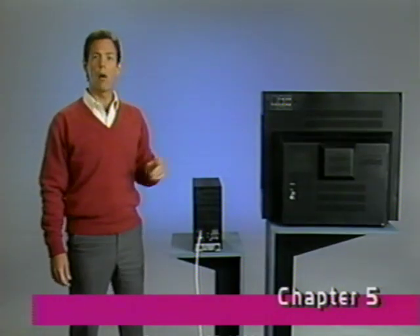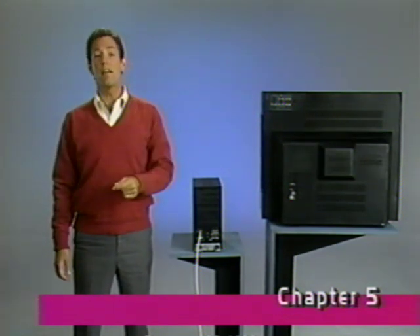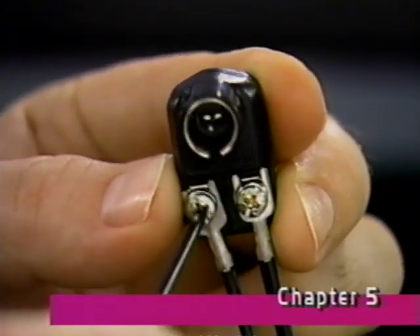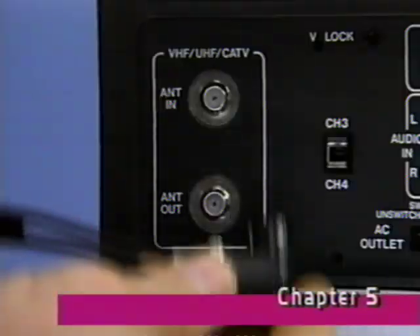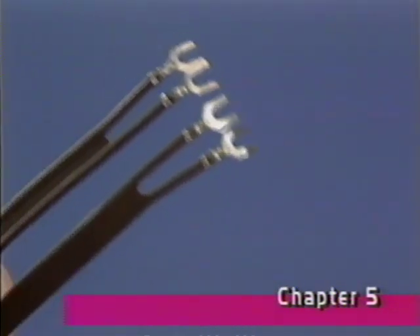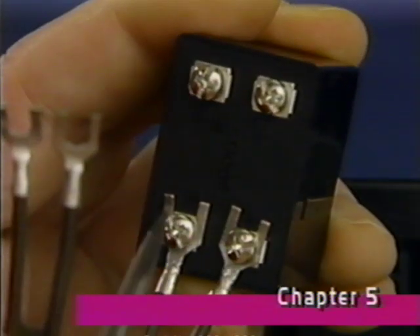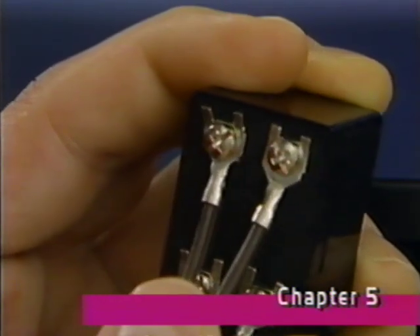Your VCR can now receive everything your TV set's been receiving. On the other hand, the end of your antenna cable may look like this. In that case, you'll need to use the antenna balun, which was packed in with your VCR. Attach the two antenna leads to it like this, and then slip it on to the antenna end jack. However, the end of your antenna cable may look like this, in which case you'll need to purchase an antenna mixer and attach it to the twin UHF-VHF antenna leads, and then slip it on to the antenna end jack.